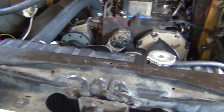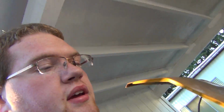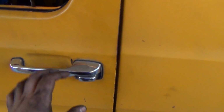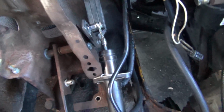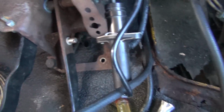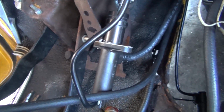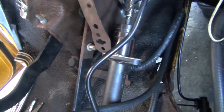So it runs. It's got a throttle shaft leak, and timing advance is kind of goofed up because one of the sensors on the block is broken. We came up with a little clutch rod setup here. I know it looks a little kludgy, but it'll have to do. Yeah, we got a lawnmower gas tank for the brake reservoir. This clutch is actually for a van. So we're just trying to get the freaking thing to bleed.